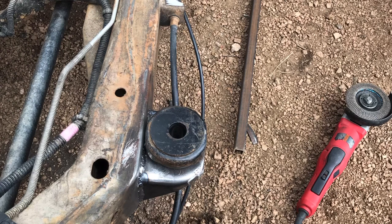After I started lightly going public with the pictures of this build, there were a lot of people asking me, hey, did you do anything with the frame to make this work? And the answer is yes. I had to move in two of the body mounts right underneath the hinges of the doors. I had to move those in exactly an inch on both sides, and then I had to actually shave down the very outside of the body mount to make this fit on the car. If I remember correctly, the Beretta from inner rocker to inner rocker is 52 inches, and from inner rocker to inner rocker on the Blazer was 54 inches.